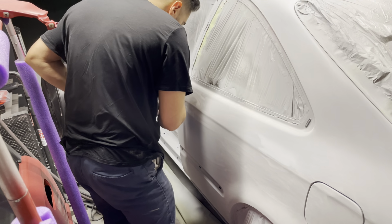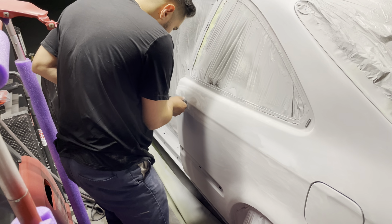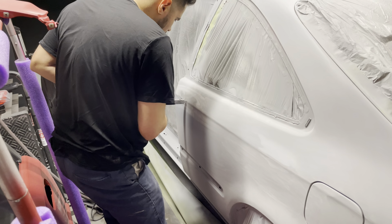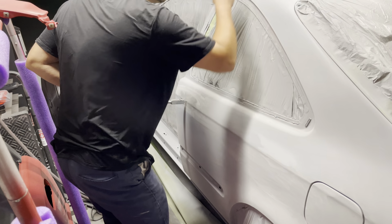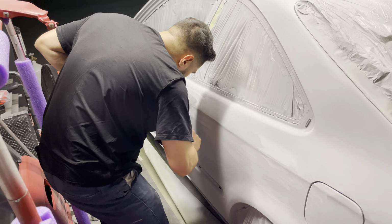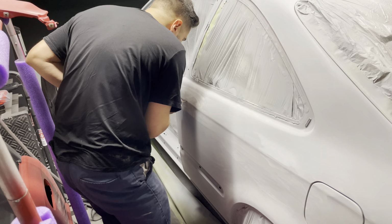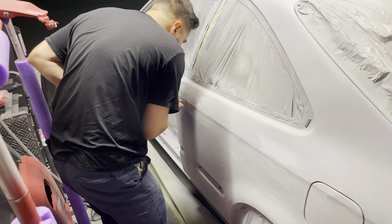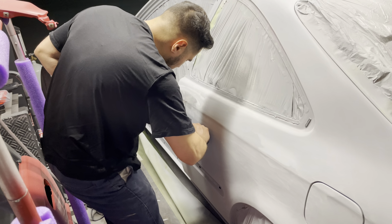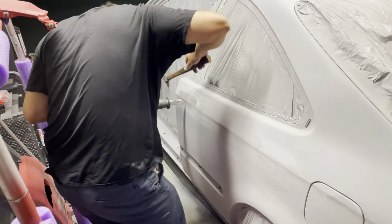Anyways, moving on, we're going to go ahead and pull a little bit on that dent because I did notice that the body still was kind of pulling out as I was pulling that dent out. So what I ended up doing is sliding hammering that body line and then knocking down the surrounding areas to get that body line to be higher than the other areas, because I noticed that as I was pulling, everything was kind of pulling together and not really the high spots where I wanted them. So I ended up just hammering down those areas to get a more defined body line.